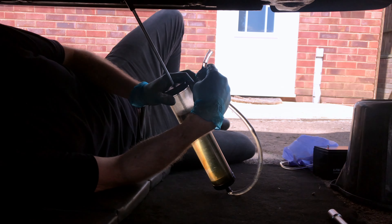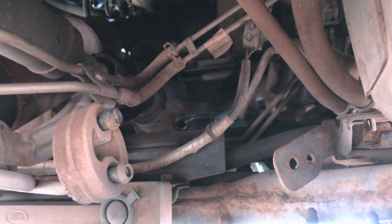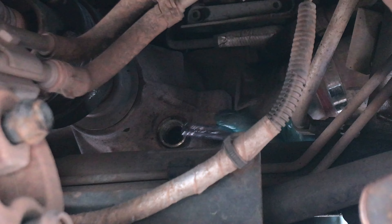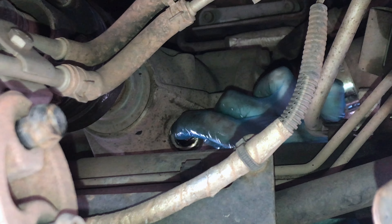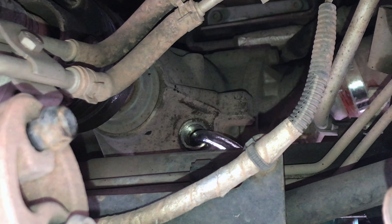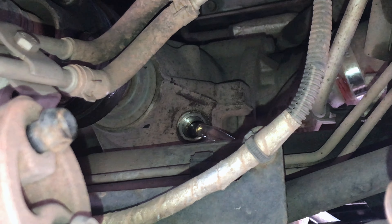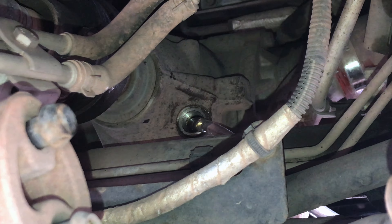Join us back at the end of the car — Ben's got the fresh oil in the syringe and we're just going to pop that back in there. Put the tube in as far as you can — it's going to be very fiddly. There we go — it's going in at a nice slow rate, we don't want it sloshing out. We've got 500ml in the syringe because we took out 500ml in the jug.